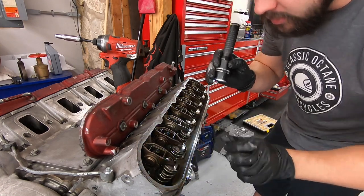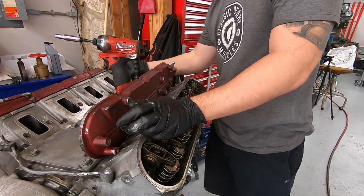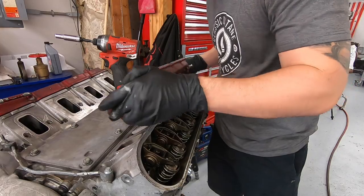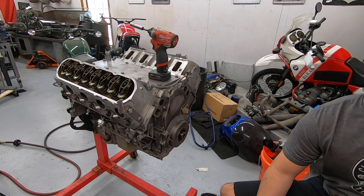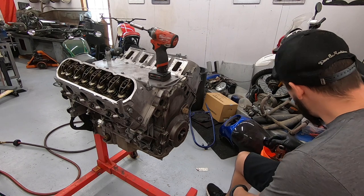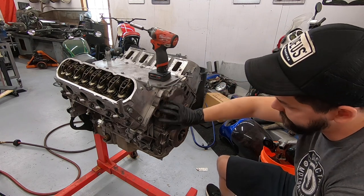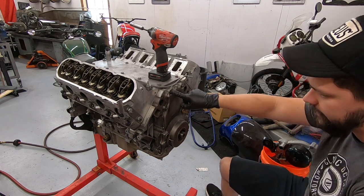Sweet. So I'm going to go ahead and replace these gaskets. One of them, this side over here, is blown out on the back. So I know that was definitely causing some oil problems, but everything else looks great so far. I decided to give the valve covers a coat of paint, since the wrinkle red that the previous person put on here was all chipping off and it looked really bad. Just pulled off the water pump, all that looked normal. I have already noticed that we are missing a bolt for our front timing cover. This is the side of the engine that had the most oil on it. Hard to believe that all of it would come from this, but it certainly doesn't help.